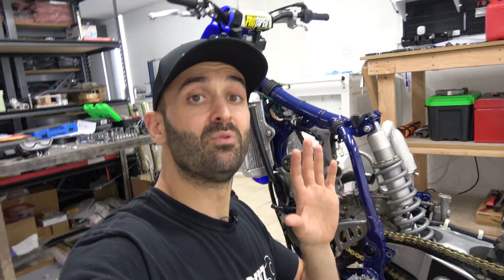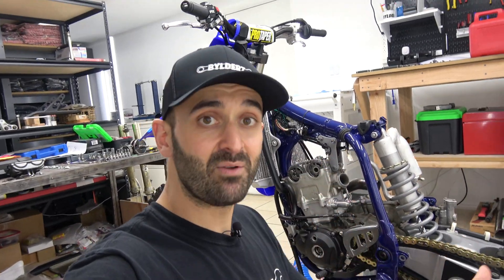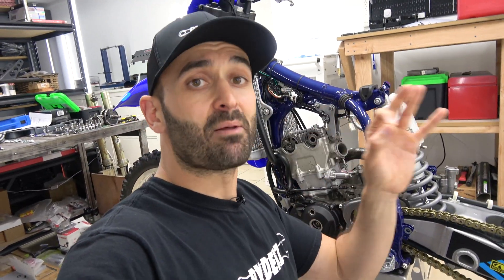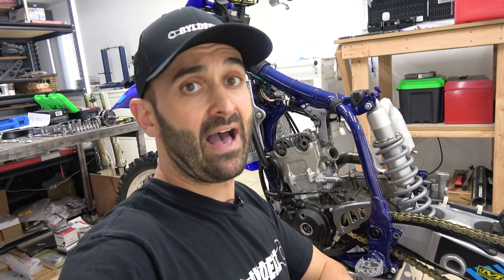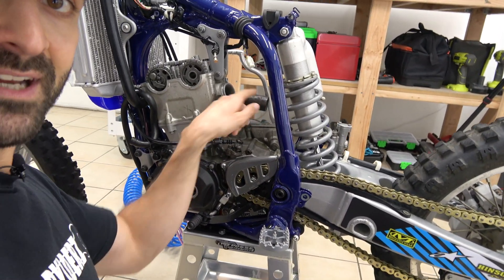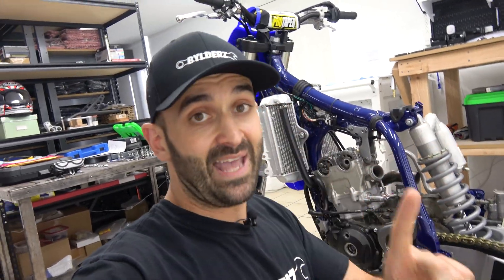Quick note here — if you're doing this procedure I'm assuming you know how to remove a few things on your engine. I removed my spark plug, my cam cover, and my carburetor because I want to be able to hear if something is coming from the intake valves. I left my exhaust manifold because it's still possible to hear with that one. Now let's plug the tester on the engine.